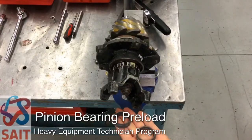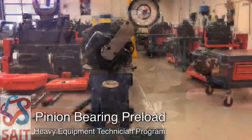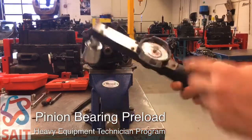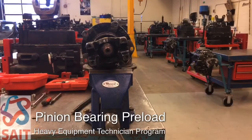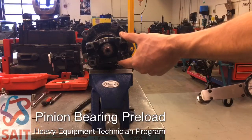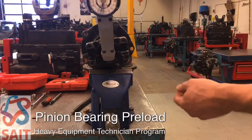To make the adjustment we're going to be increasing the torque. We mount a dial torque wrench and rotate it through, measuring the rolling torque using this face — and this one's rolling torque is 14 inch-pounds. If that rolling torque is insufficient, we would simply mount the yoke in the vise, torque the yoke nut a little bit more — five or ten degrees at a time — and the rolling torque of our pinion would gradually increase.